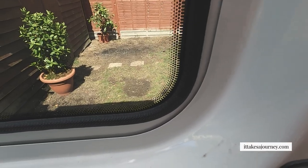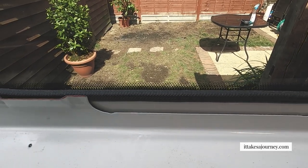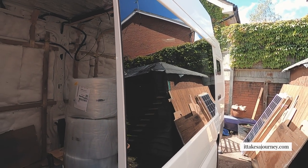Trim is something we had questions about when looking into windows — there was no obvious answer about whether you do or don't need it. The answer is it doesn't matter, it's all for aesthetics: do you want to cover up the bare bit of metal or not? On our sliding door window we put some on, but on our rear window we haven't used it because the window fits into the hole and covers the bare metal. The small window fitted fine despite our worry about the curvature of the long wheelbase van. Now we've got two shiny windows — the privacy tint works really well, you can only see in if you stick your face right up to the glass. If you found this video informative and useful, please give us a thumbs up.